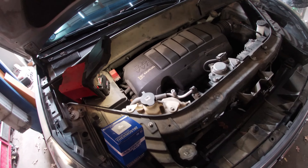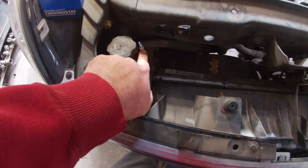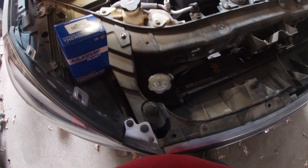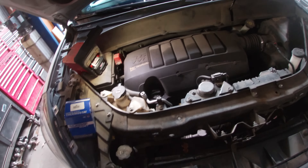They also had an issue where they didn't have a band clamp on the return line off the radiator — that was weird. It was leaking slightly right there. Got that fixed up, but for now we're gonna get in here and get this thermostat changed.